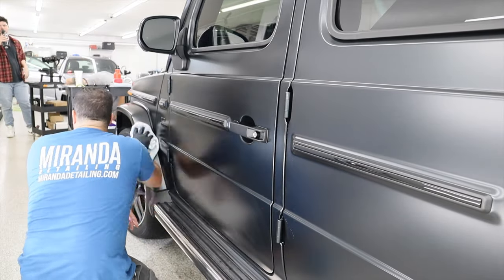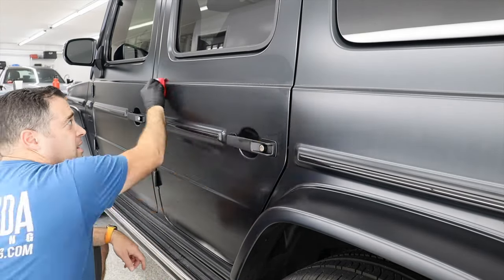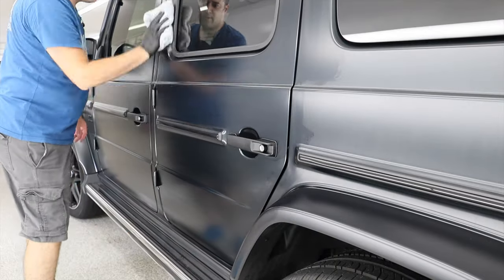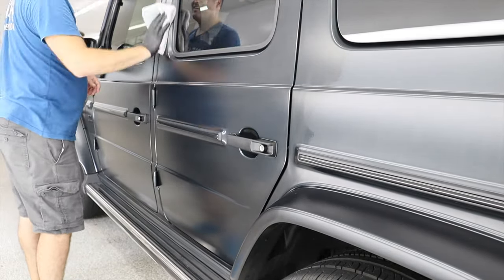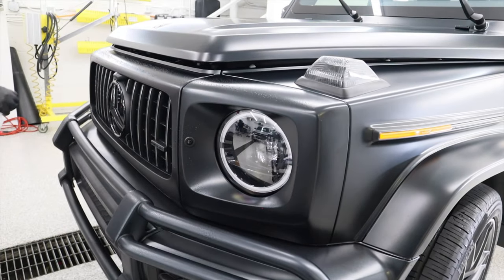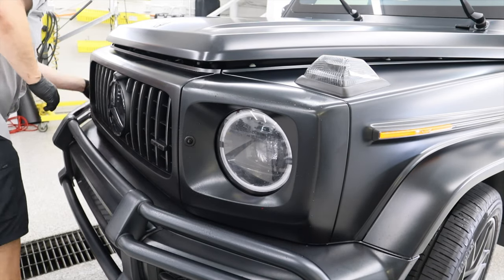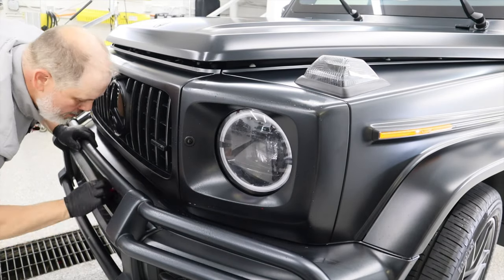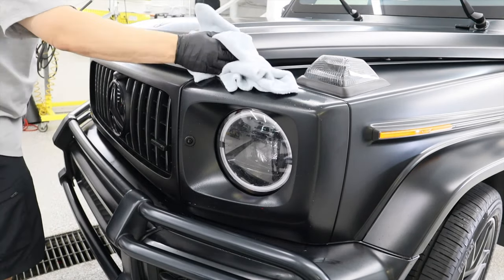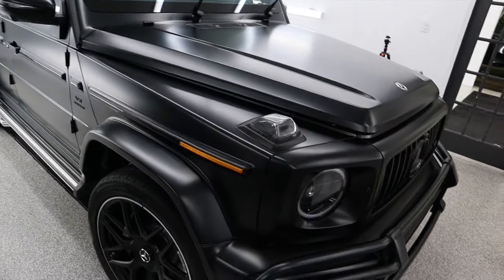Detailers need to find the process that works within their SOPs to make it efficient. For some, more water is faster — especially if they're holding the car overnight. Working with a 100% solids coating is a unique beast: in some ways more arduous because it's thicker to push around and pull off, but in many ways very forgiving with that long work time compared to products where you have only 35 seconds to wipe off. The coating is now all applied and done. We're going to bake this overnight and see what it looks like tomorrow.